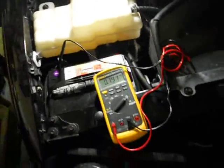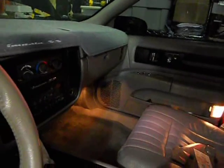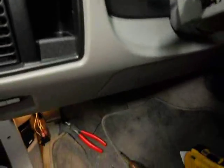That's how you check for a load. If it's high, you basically have to find all your fuse boxes. There's one under the hood in this car, and there's a fuse box inside the car too. Sometimes you have a couple of fuse boxes underneath your dash — it could be on the passenger side or under the dash and on the side. Consult your owner's manual or service manual so you'll know what goes where.